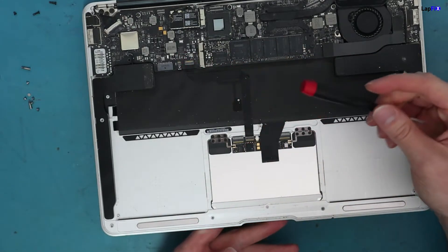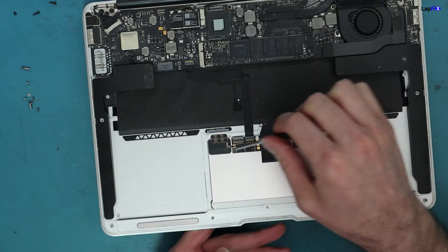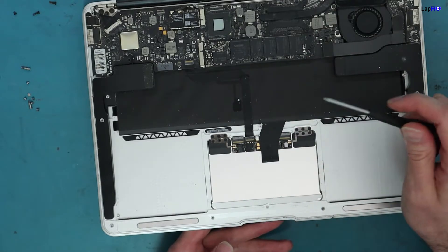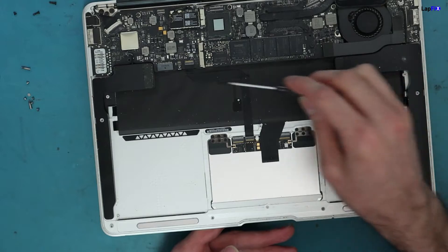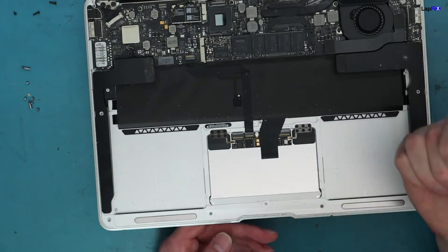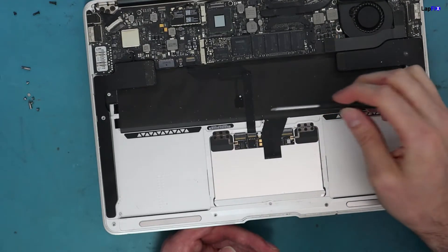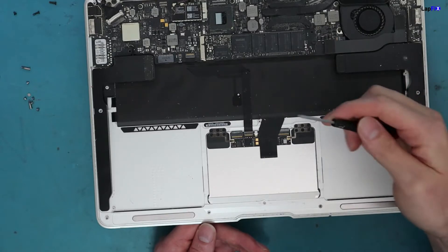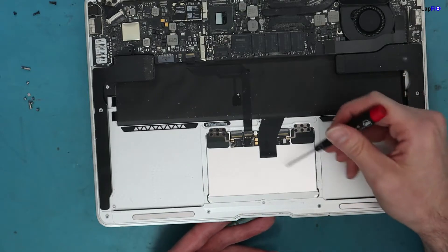It's very rare that you need to replace just the cable, unless there's been liquid damage or corrosion that affects the components on the trackpad. You can also see that the keyboard cable goes to the actual trackpad as well. So if there's a problem with the cable or it gets disconnected, you lose both the keyboard and the trackpad. This applies especially on the newer ones — the M1, 1706, 1708, 2016, 2017, and through all of them pretty much. If you have a problem with the keyboard, you may have a problem with the trackpad and vice versa.